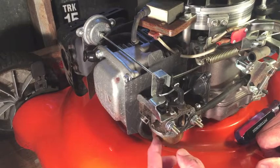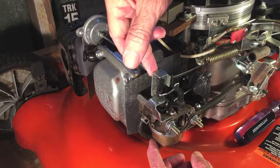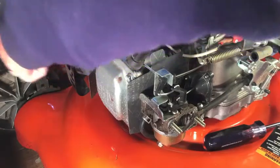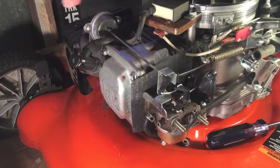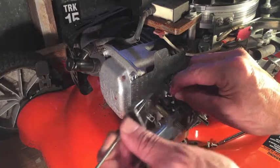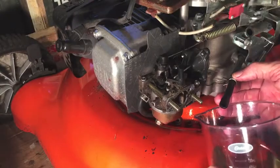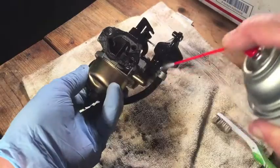I'm going to take the carburetor off, take the bowl off, and clean the main jet out. I'll need to remove the temperature switch for the choke — that's the only way to unhook this arm — and then this bracket has to come off too. There are two T20 Torx screws holding that on, and these 10-millimeter nuts have to come back off. I'll also have to drain the fuel tank again. When I reinstall this arm, I just have to remember it comes up from the bottom.